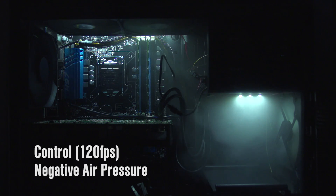For our first test, we're going to try negative air pressure — that's more air being exhausted than being taken in. Here you can see we're getting a lot of the fog right up front where it's being taken in through the intake. And then you can see it flowing up to the top of the fan and it's getting sucked out the top pretty quickly.